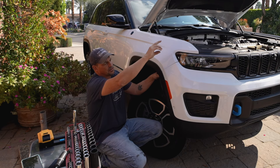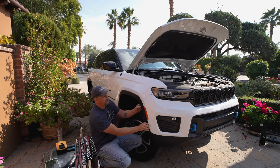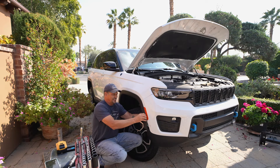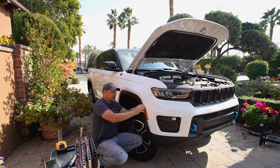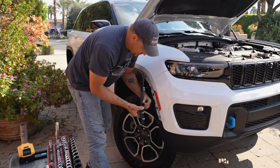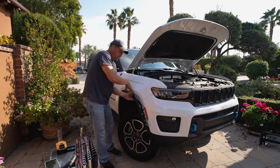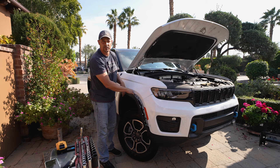So now we've got all of the screws off the top of the front fascia and all the screws off the sides. We need to pop off these little plastic trim pieces, which are just held in with little clips — you gotta be careful and pull on them, but if you squeeze the clip from the inside it comes out a little easier. We're going to pull this back and stuff a little rag in there just to keep it away from the fascia, then do the other side, and then climb underneath the Jeep and finish the bottom.